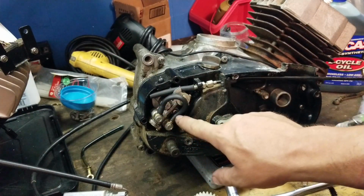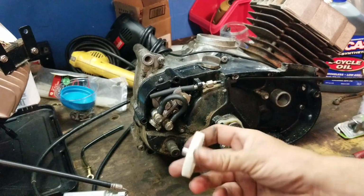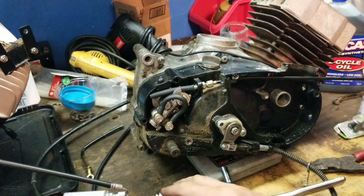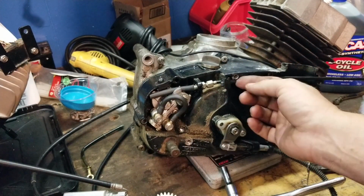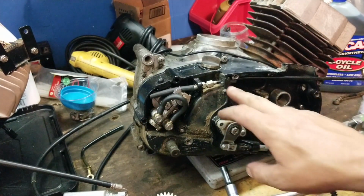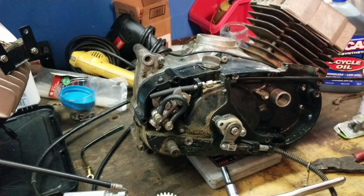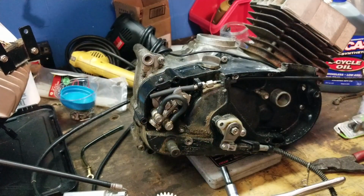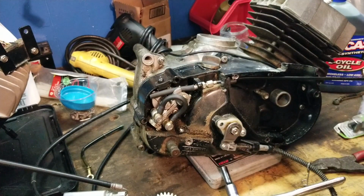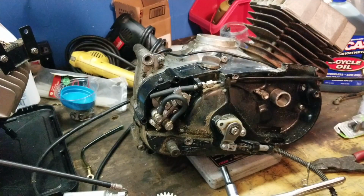We've put a loop hose on there filled up with a little bit of oil. That way oil can circulate back and forth without destroying this gear. We moved over to here. We took a piece of the oil hose, we cut it down, we filled it up with silicone, stuffed it back through. And that's so no debris can go from here to here or from here to here. And it doesn't create a lean condition from sucking air. So these are very important things to do. Very, very important. Now, the most important part of the entire job is the last but not least.